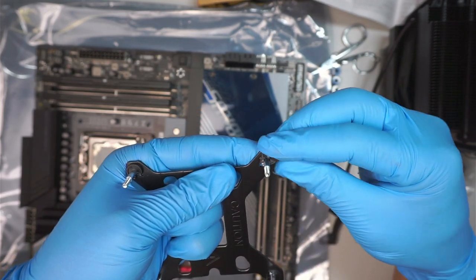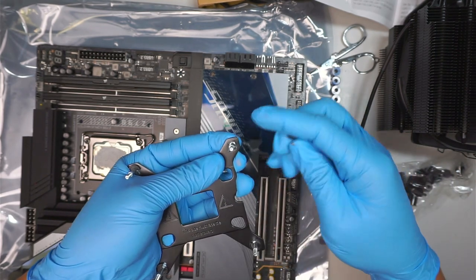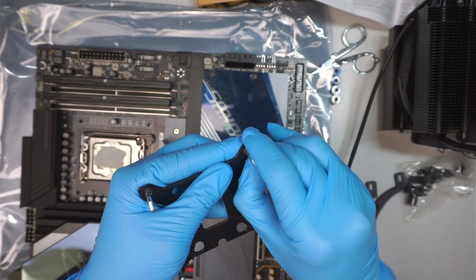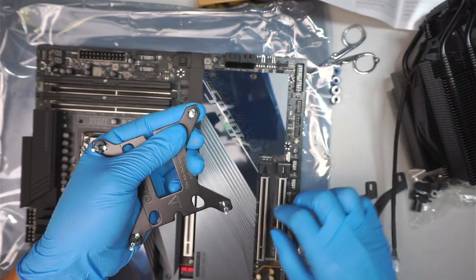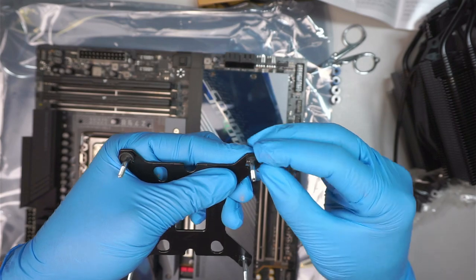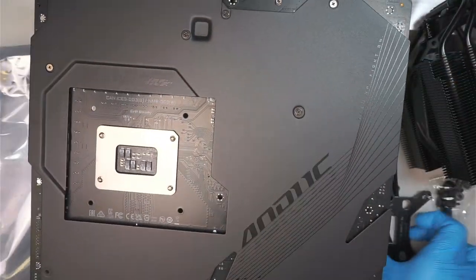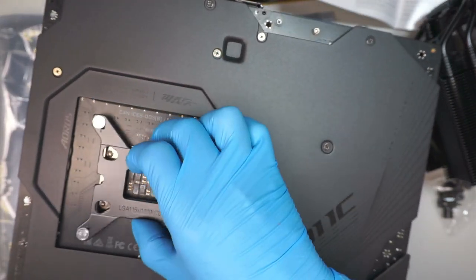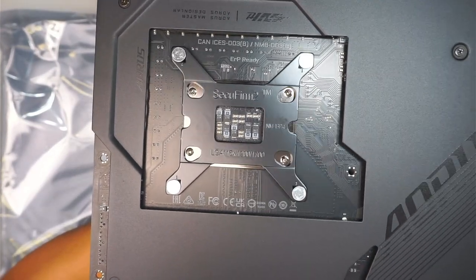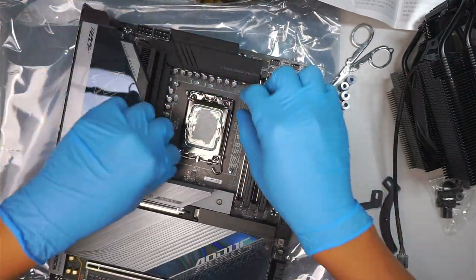The good news is that it is easy to just pop the clipper open again, pop the clipper out, and then redo it again. So that is the easy side of it. Okay, once you're done with that process, let's try again. Lift the motherboard up, tilt it, realign, and match that screw all the way in. And that goes the bracket. I'm holding this still, flipping it around because you do not want that metal bracket to drop. I'm holding it and kind of lifting it up. There we go.